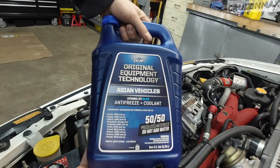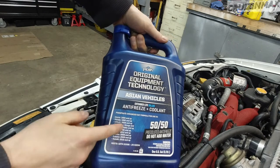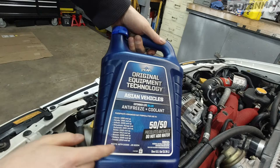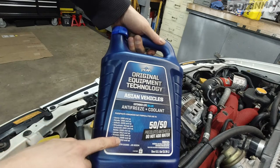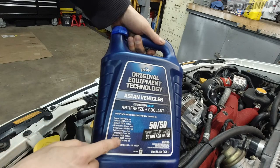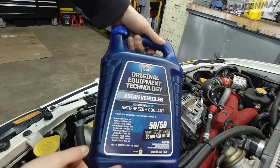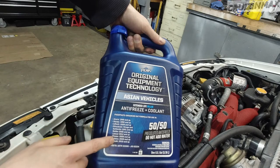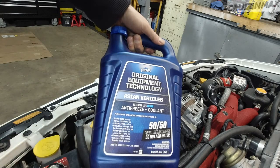This is what I got - already diluted blue coolant. This is good for mostly Asian cars, Subarus all 2009 and up. But the block is the same in older models all the way up to 2004, even probably before, so it's okay. It's safe for older Subarus.